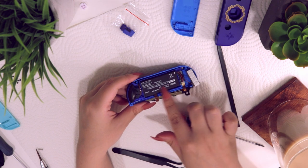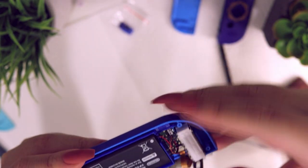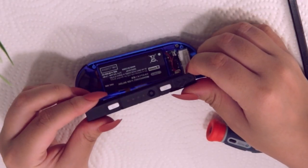We are nearing the home stretch for the first joy con. Put back the ribbon cable onto the board, sliding it in very carefully in reverse, and make sure to shut that latch back down. Next add another spring for the other shoulder button — there's a little cross where you put the spring, and a groove where the spring sits. Carefully flip this back, fit it where it should go, and it should easily slide right in. Put back the same three screws, flip the battery back making sure the wire faces the open gap at the bottom, and pop the rumble back in.